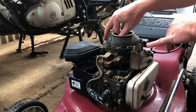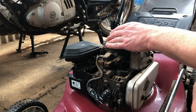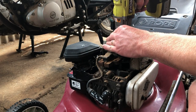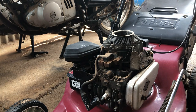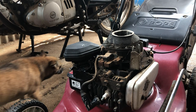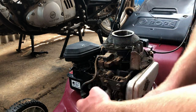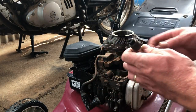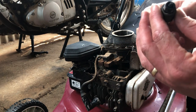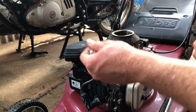But combining it with our hard starting, it might be an ignition coil problem also. Had a couple like that before. Righto. Pull this plug out. Plug's black, not fouled with oil or anything in particular really. I'll clean it afterwards and leave it be.